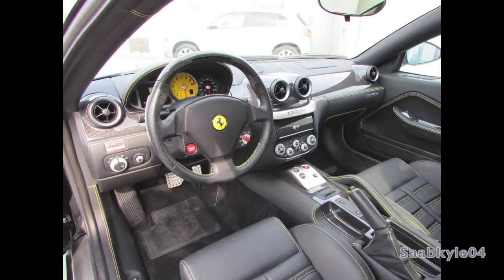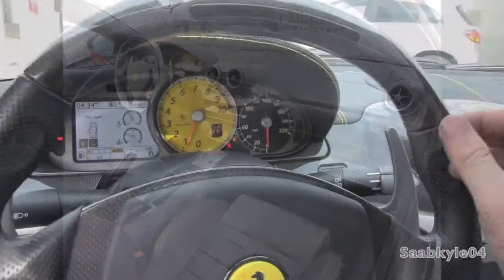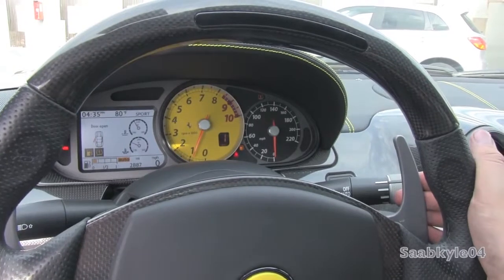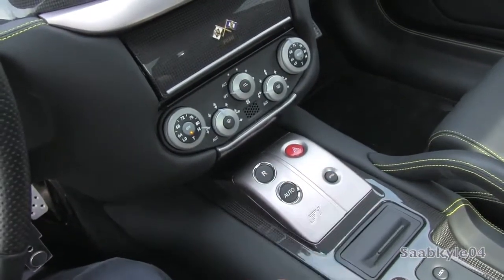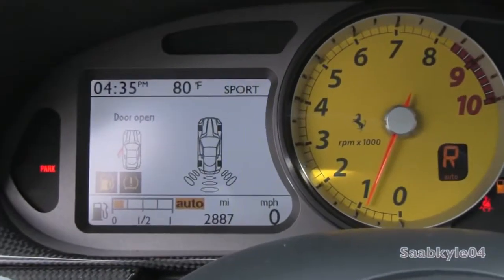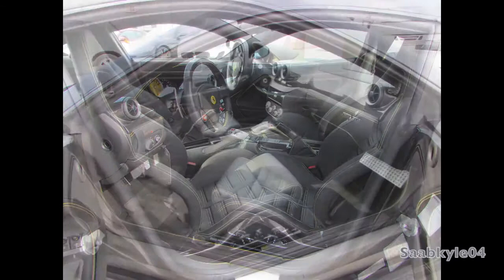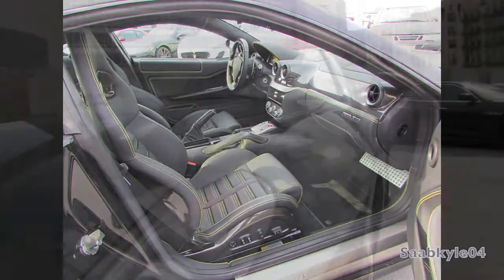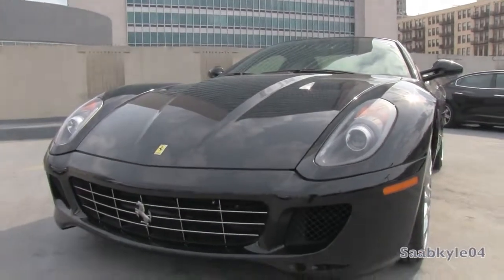It's capable of lightning-quick 100 millisecond gear changes in high-performance driving, shifting faster than an F430 by 50 milliseconds, and is 150 milliseconds quicker to shift than its predecessor, the 575 Maranello. With that, there's also a full auto mode with enhanced smoothness thanks to a new twin-disc clutch. Gears can also be selected manually via the steering wheel mounted paddle shifters.